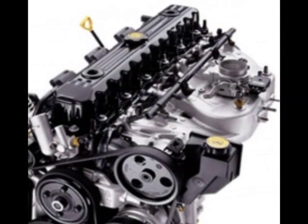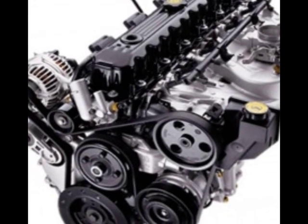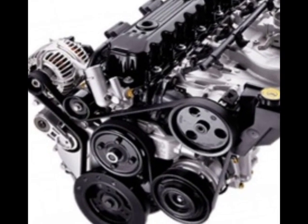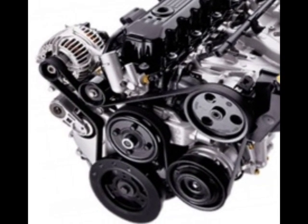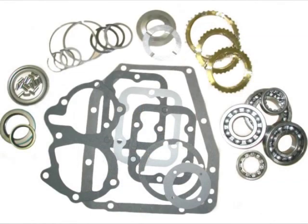The four-liter Jeep I6, both the Renix and Mopar systems, is adaptable using the same method with the addition of installing a crank position sensor into the aforementioned bell housing. The SM465 is relatively simple to rebuild. Many choose to do a full rebuild during the adaptation process, and the instruction guides feature all the details, diagrams, pictures, and tricks required to do professional level work. A link to the rebuild kit is provided in the description below this video.